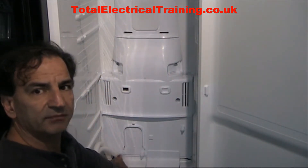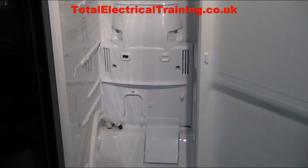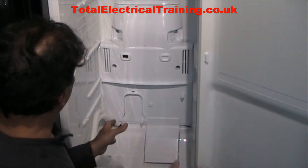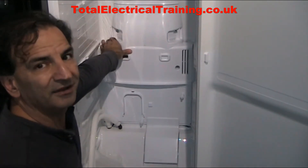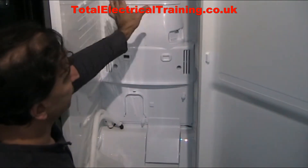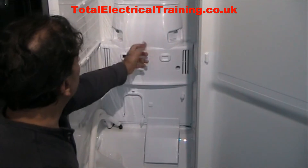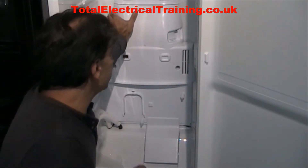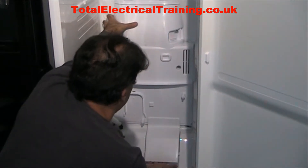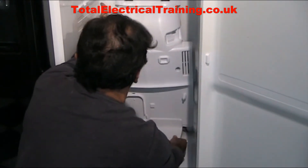To take the panel completely out, I waited for the ice to melt away and removed as many chunks of ice as I could by hand from the top. Then I switched the fridge freezer off completely — unplug it or switch it off from the socket, which is safer. Once the screws are out, put your hands in the space and pull it back. At the bottom you have a plastic flap just for pulling it out — it has no other function. Then you pull it out and it comes out.